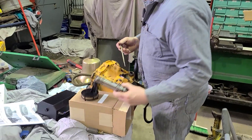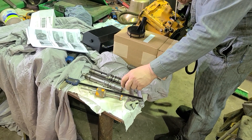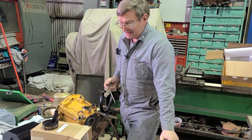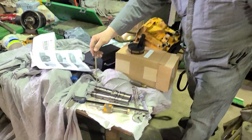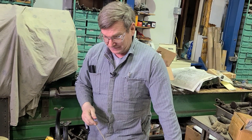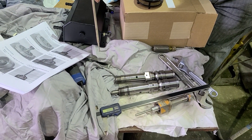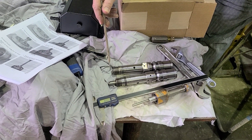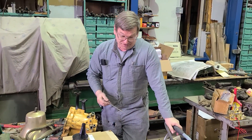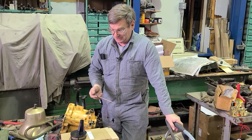We have got a replacement spool that was supposed to be like this one but isn't. However, it has all of the important functions — the holes are laid out in the same area — and the only real difference is that it actuates with a different style of solenoid. We can take care of that because we don't need solenoid operation anyway. We'll make a nut that goes over this and pushes that button in with a set screw. We'll run the set screw in, put a lock nut on it, and that'll hold it in the always-engaged position. Even though it's new, it's the earliest version of these, which is just the opposite of the later one. The diameter is also different on those — I don't know if that was so you couldn't mix them up, or whether it was a replacement piece for a worn hole.